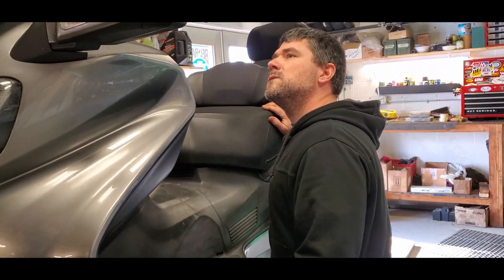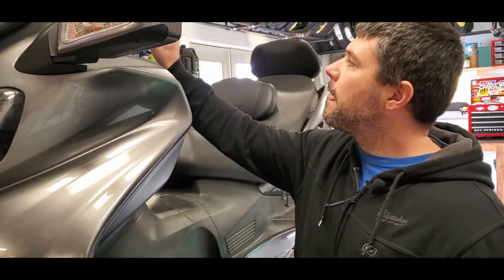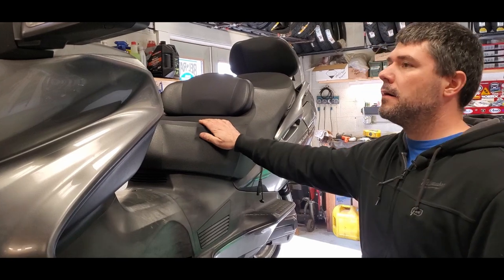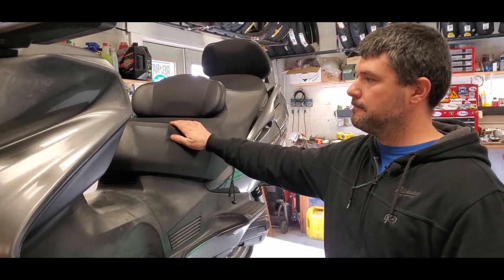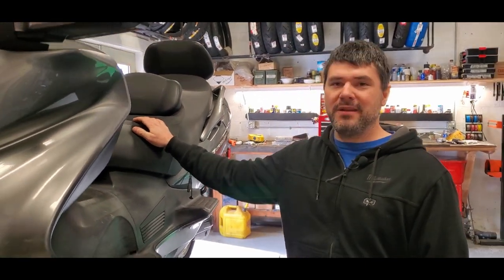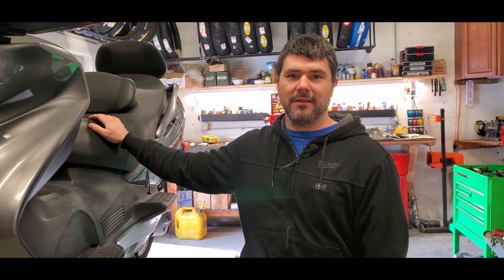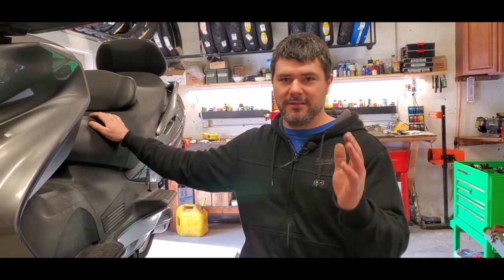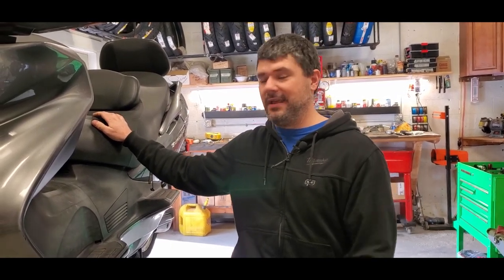So a little bit of a top tip today is make sure that we're checking tire pressures before you go ride. I'd say every week you should probably be checking your tire pressures, and make sure valve stem integrity is there. It takes 5 minutes to look your entire bike over, checking the lights, checking tire pressure. Really get in the habit of doing it. It's only going to help you, and it could potentially save your life.